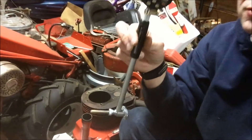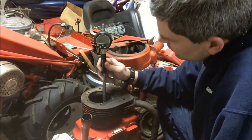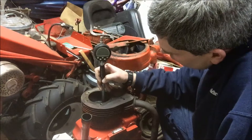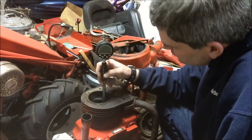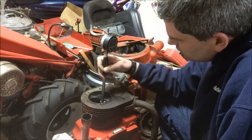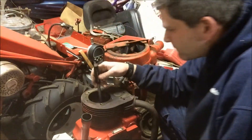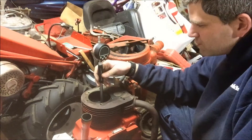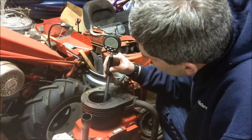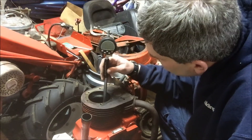I've got this zeroed out at 3.5 inches. I've got this 14-horse Kohler here from my 814 and I'm going to put this in the cylinder and go up and down. I'm getting 3.504, 3.5029, 3.5003 — so it's really not that far out of standard. The question is what size piston do I need. I'm also seeing 3.5016 and 3.5025.